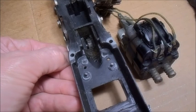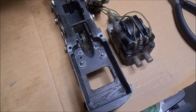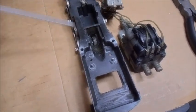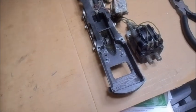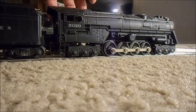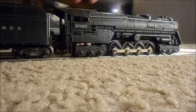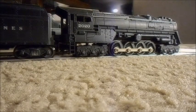It could be sticking inside of that gear, but what I've seen before is on the insides of these drive wheels — clean all inside all of them with any kind of solvent, WD-40. You're going to find a lot of grease; all the grease from in here gets forced out. These are from the early 50s, maybe even the late 40s, so that stuff's dried out. I cleaned it all out of here already — there was so much dirt and lint in there. Let's see what it does when I hit the reverse button. Every time — that's why it sticks. It sticks on the inside of the drive wheels because it's always moving it to the side like that. This is why it sticks if the inside of the wheel is sticky.